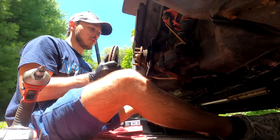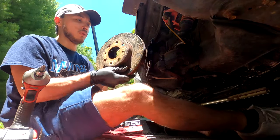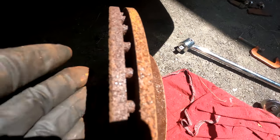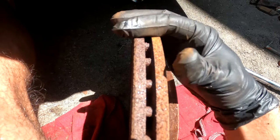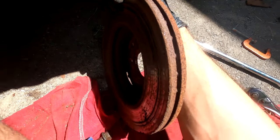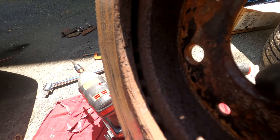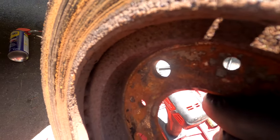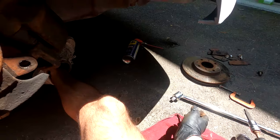The rotor is ready to come off - just gently remove it. Here's our old one, and you can see why it needed replacing: there's corrosion all around the ring of the rotor, it's clearly been on here for many years, and if you look at the back you can see how crusty it is with some separation going on. Definitely not what you want, so glad we have that out.